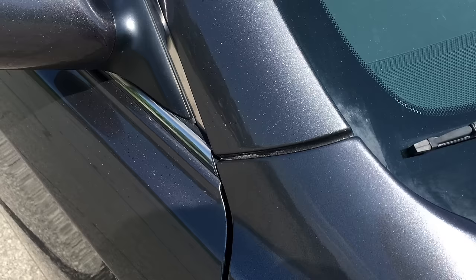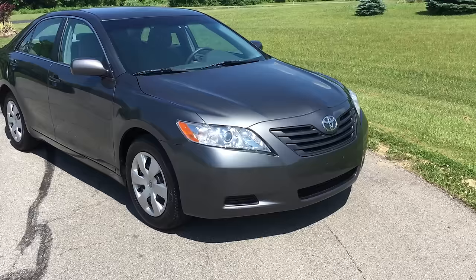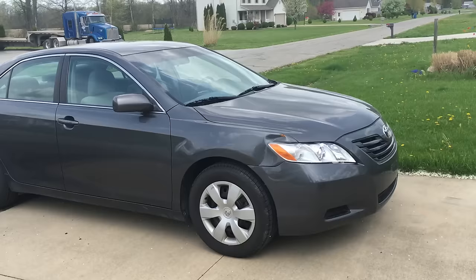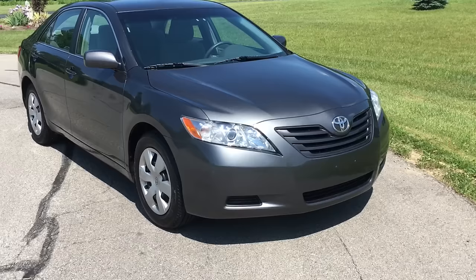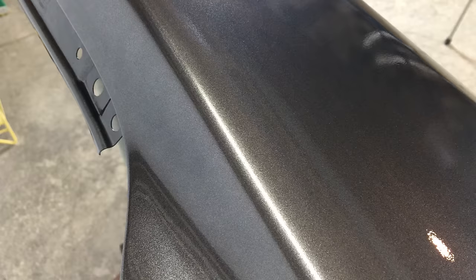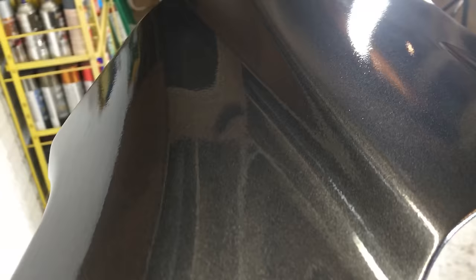Again, because this is fresh lacquer paint, it's soft enough to easily polish by hand or with a low speed orbital buffer. If I wanted to wet sand or polish further, I would have applied more coats of clear to allow safe removal of more orange peel. I brought the car outside to get a better look at the final result and I am extremely happy with this. You just saw the budget paint process from start to finish. I'm going to let the car sit in the sun for a few days to fully cure the paint and then put a coat of wax over the fender to seal and protect the new paint. Here's a look at the before and the after. For less than $100 — and that's including the cost of the replacement fender — I did this job right here in my garage. I hope this video will save you some money doing this job yourself. Let me know if you have any questions in the comments — I read them all. Thanks for watching and subscribe for more how-to videos and other project updates here at the 6th Gear Garage.